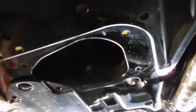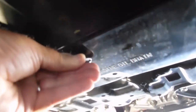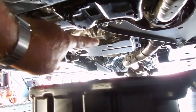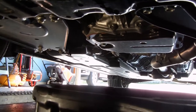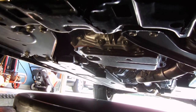I've got this back in place, so in the future you can just remove those four clips and then this just slides off to the side. I'm going to guess that if you go have your oil changed somewhere they will just remove this and you'll never see it again, so I'm going to go ahead and put it back on — these just snap into place, they're pretty easy. Where some people make an error is they don't see this plate and they go all the way back and find a drain plug — but that's not your oil pan, that's your transmission fluid. So don't make that mistake. And that's the whole reason I made this video.